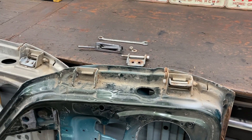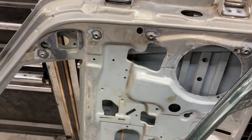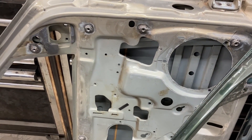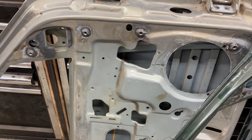A quick video here on an old repair that I made on these doors. They've since been changed out. This one is obviously all rusted out right here, and this one here was a casualty of winter where the inside panel had busted in the cold. I just welded these nuts on real quick on a weekend and basically bolted that panel to the door.